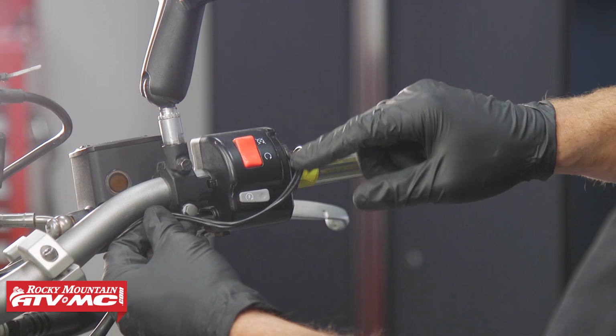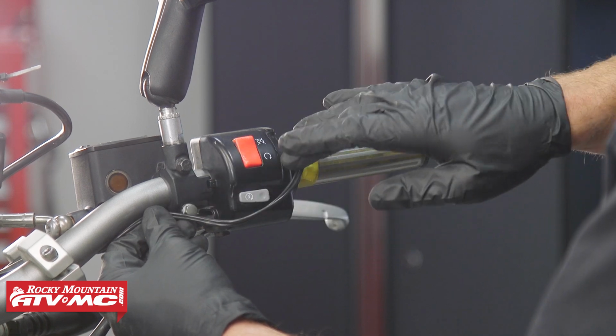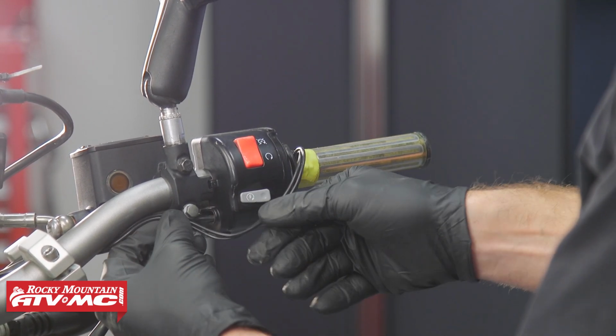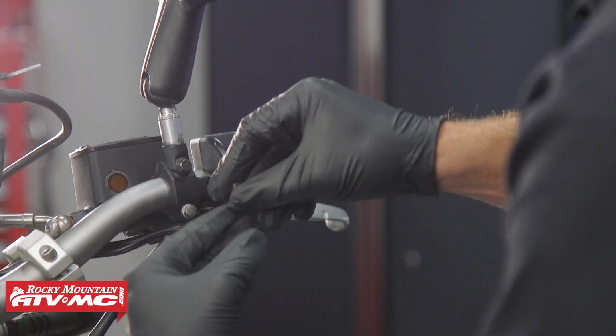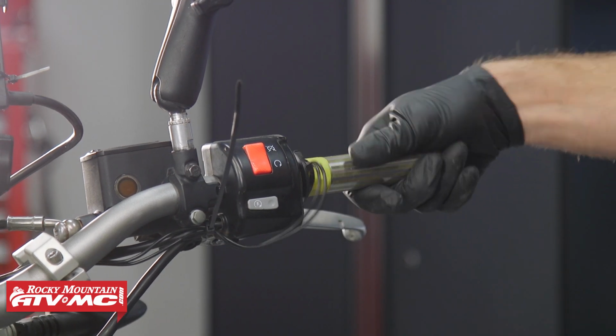Now, I can't stress this enough. You want to take up this rotational motion over a little bit longer length of wire. That way it's not moving a whole lot, and you want to make sure it's out of the way so it doesn't catch on anything or bind up and break these joints right there on the solder.